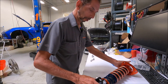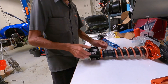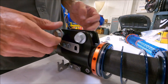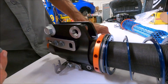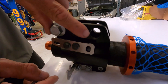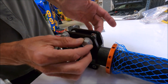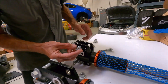I also want to show you what I call camber chips or camber eccentrics. This is where your steering knuckle bolts to. The bottom just uses a factory-style bolt where it pivots. The top bolt has a little eccentric that pops in there. This is another strut where I've pulled it out — you can see the eccentric, it's an oval hole, not round. The bolt can move back and forth, and some people just hollow it out, but they're going to slip, and that's really dangerous.